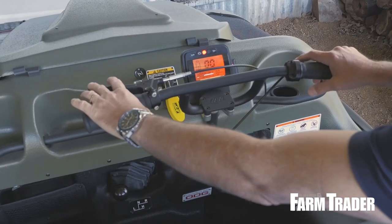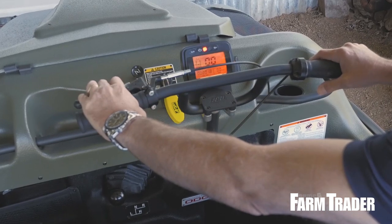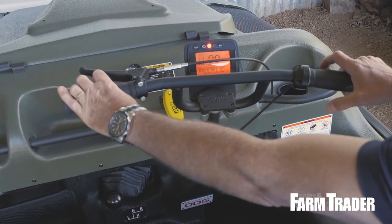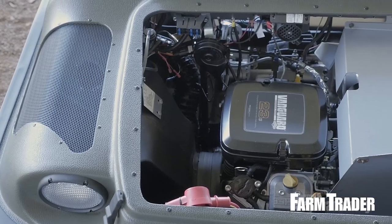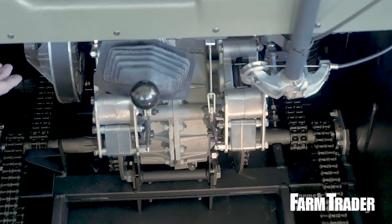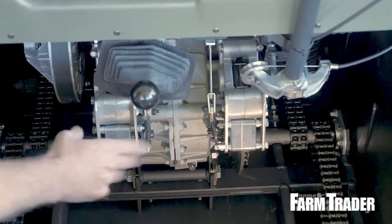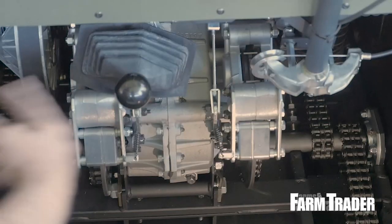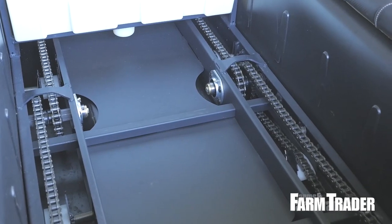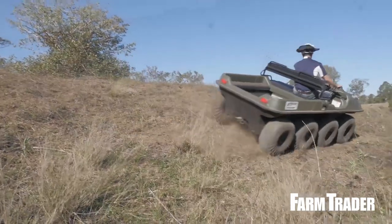This is the Argo Frontier — steering handlebars, throttle on the right, downhill brakes on the left, left hand turn, right hand turn. Basically the Argo driveline is a V-twin engine, carburetor or fuel injected up the front, through a heavy duty CVT to an Ontario Driving Gear differential transmission. Your drive is left and right, chain driven, one chain per axle. Let the Argo go in a straight line, it's locked in eight wheel drive. Turn, and it's four wheel drive one side, four wheel drive the other side.